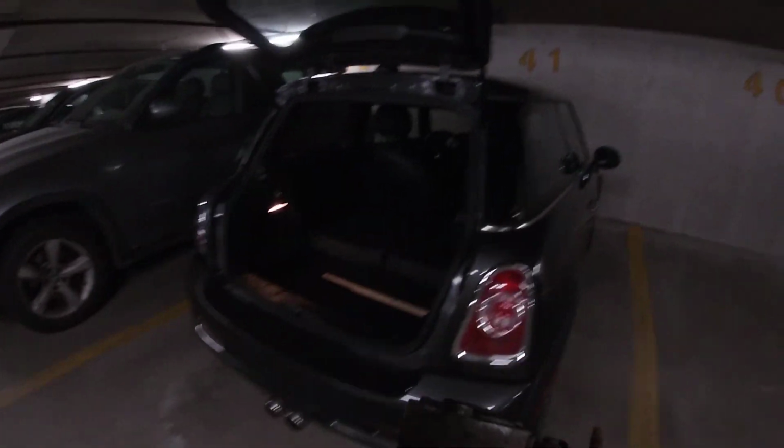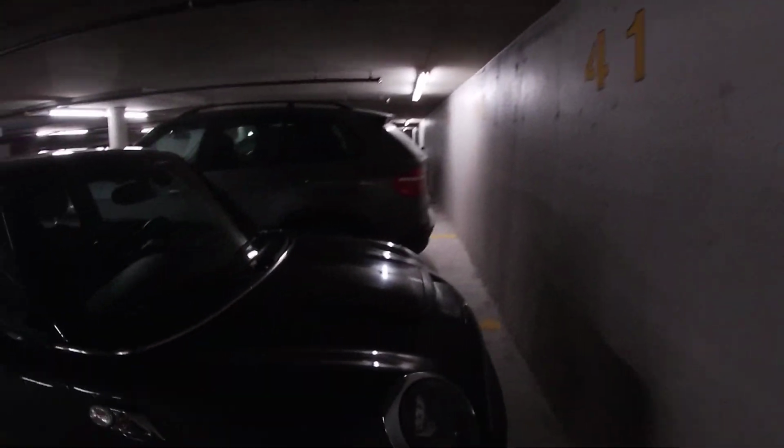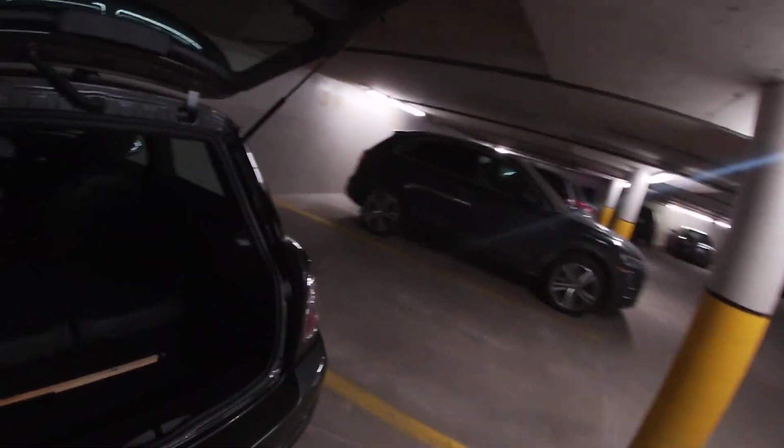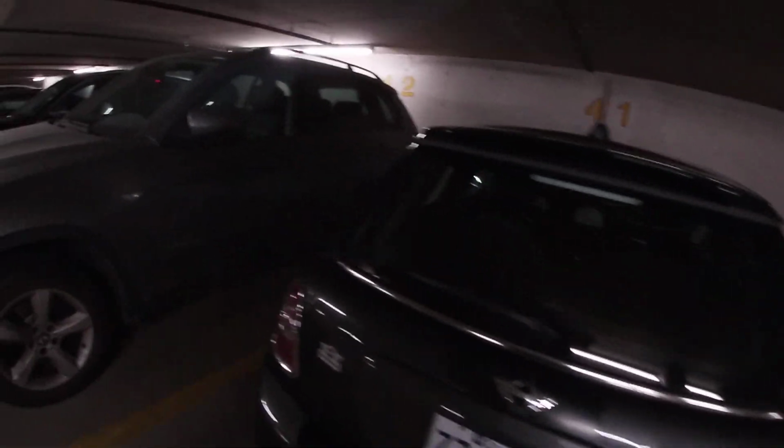Anyways, it's dark in here. I can't explain how a starter motor works, but anyways, the solenoid makes that gear move forward into the outer casing, and then that gear touches the flywheel of the car. And then it turns the flywheel of the car. The flywheel is attached to the crankshaft. And then it turns the engine over, and that starts the engine. That's how your engine starts.